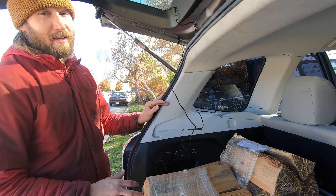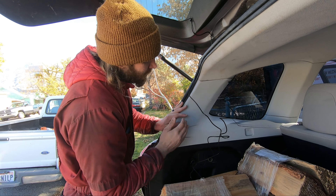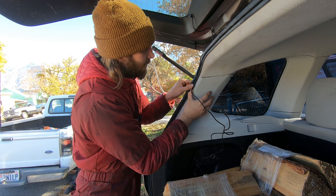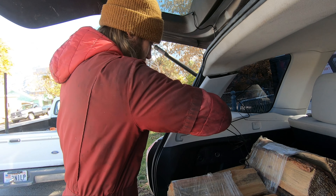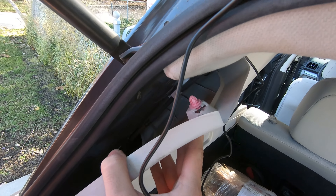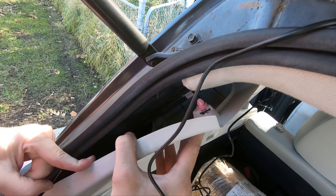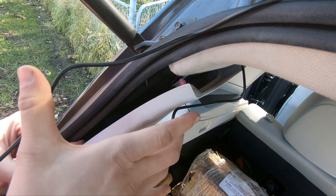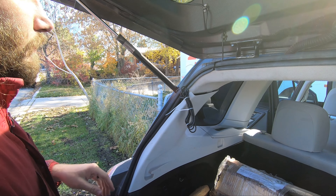So we've made our way to the back. Like I said, it's a lot easier doing all this stuff than that front one, so that took just a second. We don't have any airbags inside either this pillar or that one. You can see how much room we have inside there, so I'm just going to do a nice neat tuck. Since I've got this unpopped, I'm going to go ahead and use a couple of wire ties to hold all these wires together so they don't jingle-jangle around in there. Trim them off and we're good to go — this is pretty much over now.